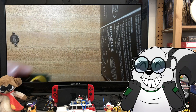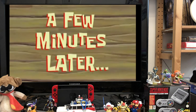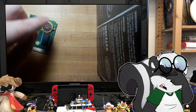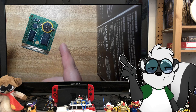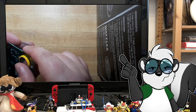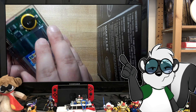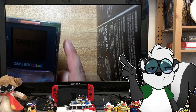And that is basically it - that is a done deal. Going to stop this for a second and test the save. Okay, I made a bit of an error. I had put the battery in backwards, so it wouldn't work. So I already re-soldered it and put it in the proper position. It's important to note which side is your positive and which side is your negative on the battery, otherwise it will not work. I tested this and the save does work. Silly mistake, but we all learn from our mistakes.